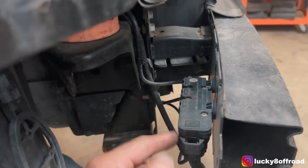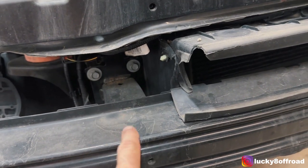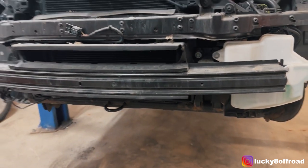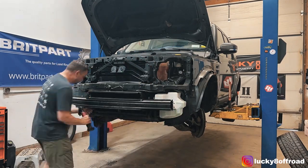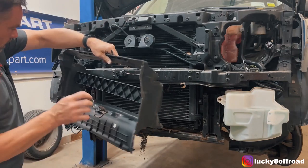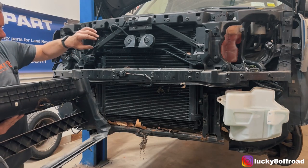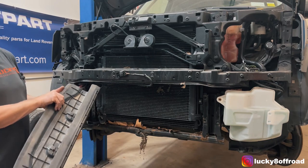With the bumper cover off, you're going to want to get the front valve block loose — just let that hang. Pull the little core support bumper support out. This little plastic air deflector is coming out. The washer bottle is also coming out. When you pop this center section off, you'll notice it's connected by a wire. What we're going to do is unclip it, get the wire off, and then zip tie it up — it's an ambient air temperature sensor, not a critical component to be right where it was, it just needs to be in front of the car.